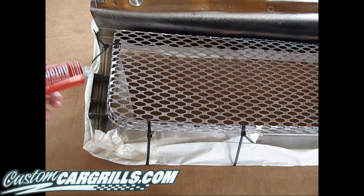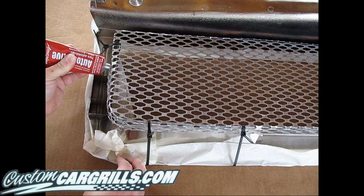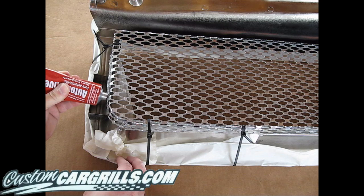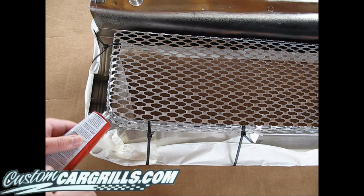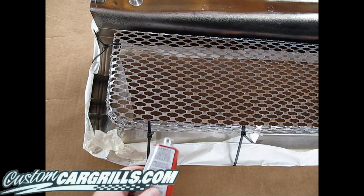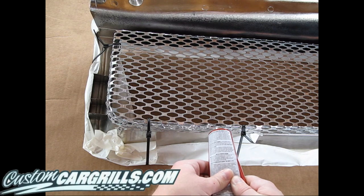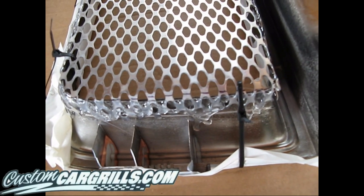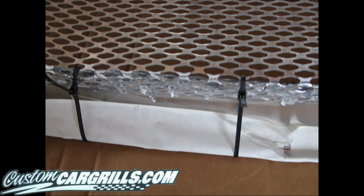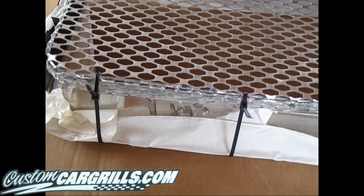Like many other grills, I like using automotive goop to attach the grill mesh to the grill. This is just a fresh tube right out of the package — I punctured the seal and I'm just going to town here. You want to make sure you read the directions on it; this is a fairly potent adhesive and you want to be careful with it. It works well but it's a fairly powerful adhesive. All I'm doing here is simply going along the line of where the grill mesh meets the factory grill. You just goop it on and that's it — it's a very easy product to use. It's got quite a bit of cure time; you're going to want to let this sit for about a day, but once it dries, it dries clear. It's relatively thin and really shouldn't cause any clearance problems when reinstalling the grill.